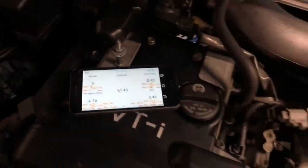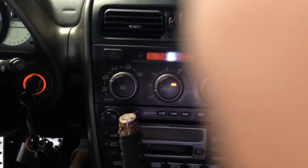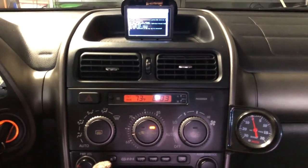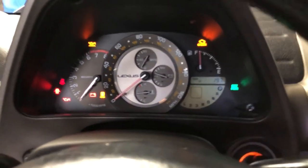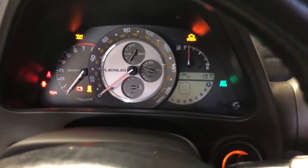That wide open throttle position puts you in open loop, and that whining sound from the motor stopping on the controls means you're definitely at full throttle. When it takes a break like that, that's you in the right spot — it will periodically do that in other positions too. Otherwise you're going to lose a little bit of performance from not being able to open your throttle all the way. Drive-by-wire stops at the halfway point, so definitely worth checking out if you have any type of extra slowness going on.